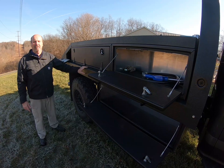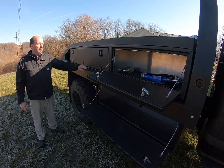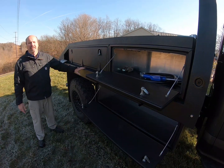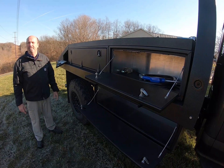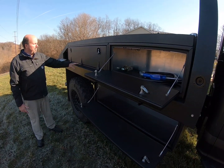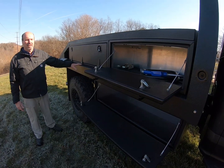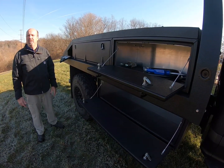So we start with that aromatic process and then do a second coat of the aliphatic resin — the same thinner material we used on the front. That seals everything up, gives cleanability, gets rid of the chalking, and keeps it nice and black for years to come. As we finish up on this custom side, our next video is going to detail all the electrical work — this truck had a lot of components and they all had to be powered up.